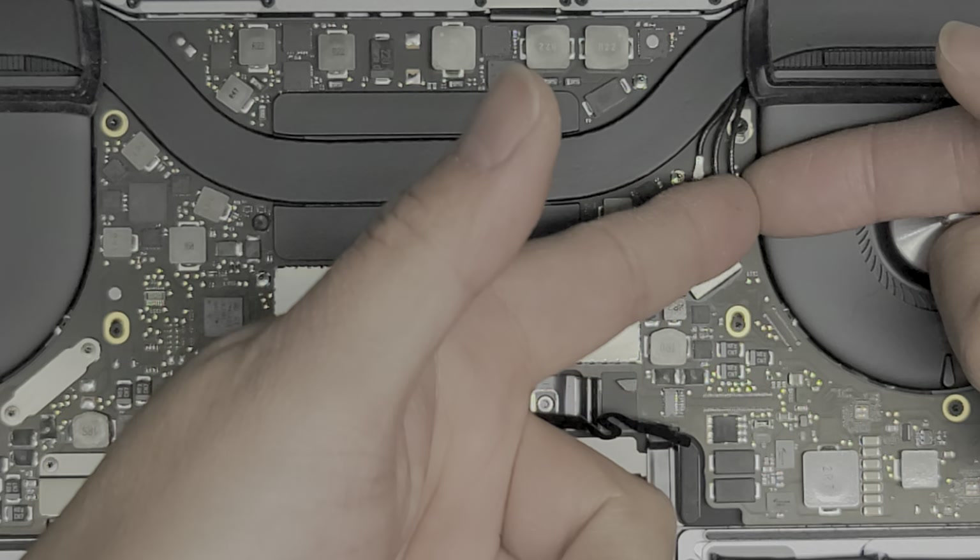Here's the wireless antenna bar — so if your wireless isn't working you might have to replace this. Usually weak signal indicates a broken antenna rather than complete failure. Now that we've got that out, we're going to remove the screen. This cable is connected to the logic board on the other side and stays here, but the whole screen assembly including the spring pieces comes out.